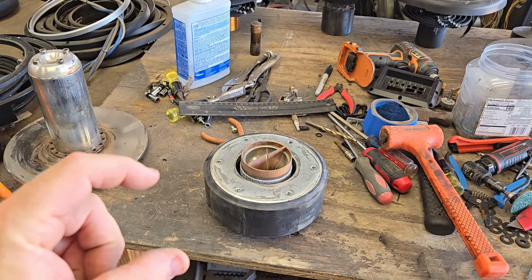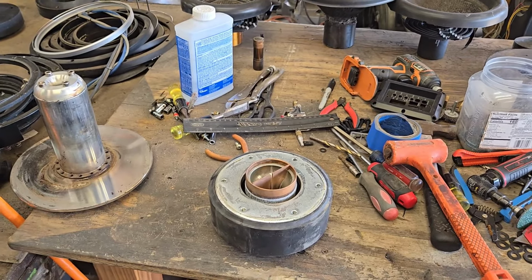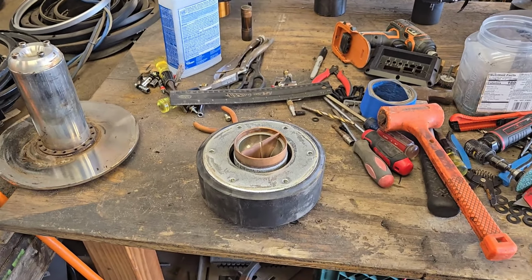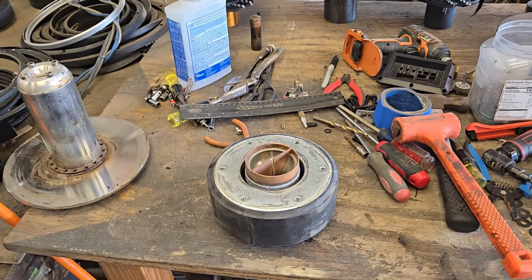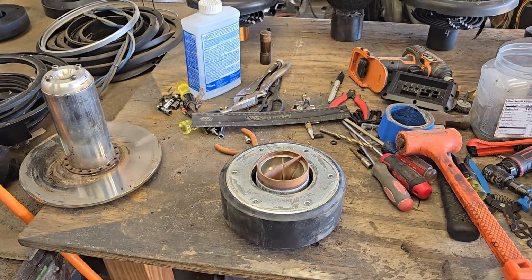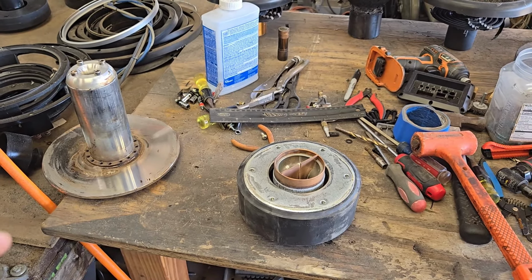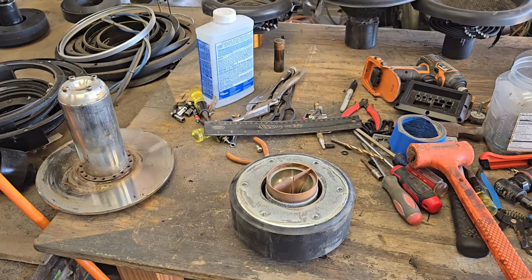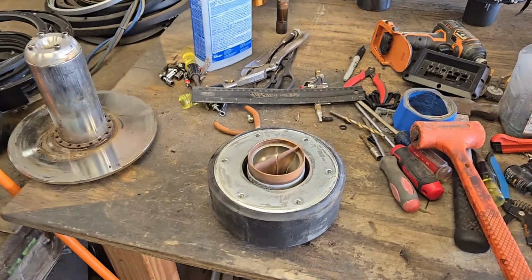Now, as long as you use a 50 millimeter coil, which is kind of a waste to use on a 10-inch spider, but you can do it. So if you really want to spruce it up, and if somebody wants the deluxe version of the Type X, that's one way that you can show them. You do have to make sure that your former height is pretty tall, and then you can get away with the GONZO cone, which is the 6 series from Lord of Bass. Does that make sense? Mega Roll.